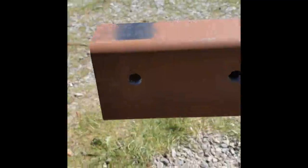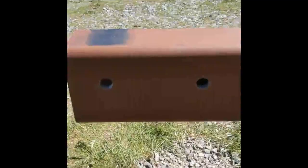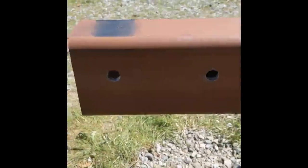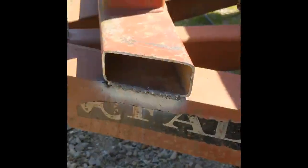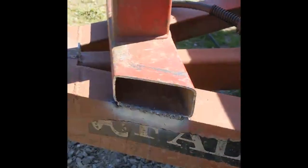We're back with our trailer modification. We've got the holes drilled for the ball coupler, and we've got our new tongue piece welded into the old tongue piece in multiple spots. There's our tie down spot, and then we've got our winch post re-welded onto the tongue of the trailer. We're about to put the motorcycle mount on.